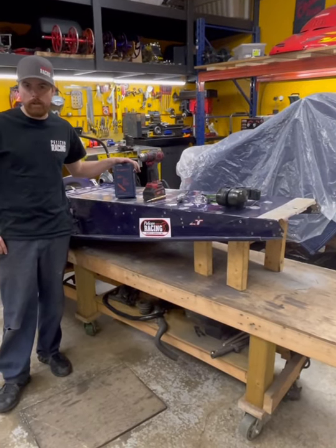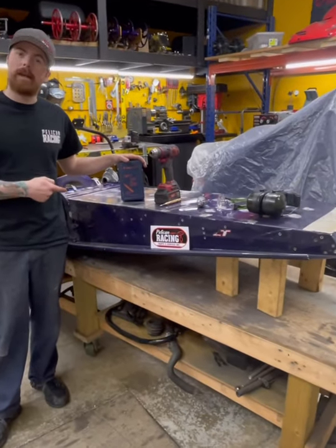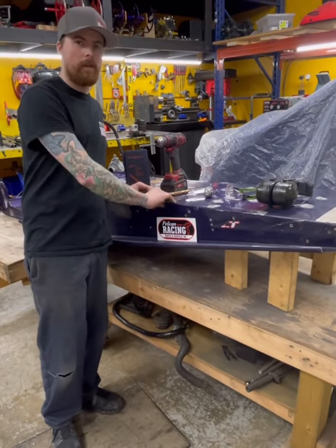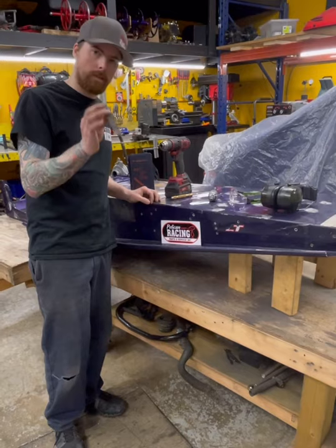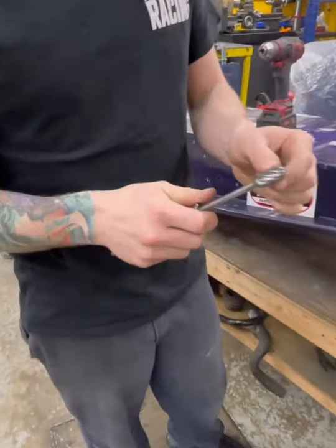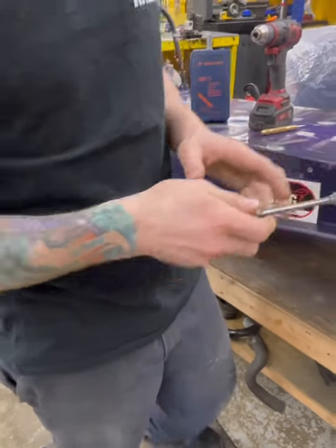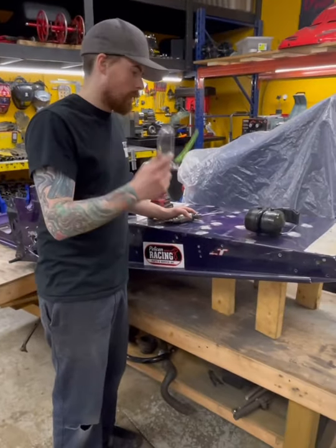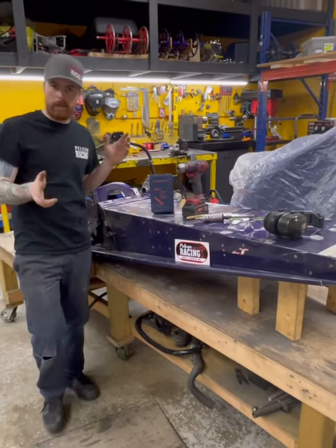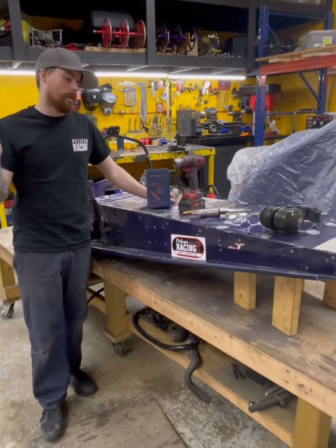Here's a quick rundown of some tools we're going to use. We're going to use a cordless drill with metric drill bits — metric, Canadian. We're going to use a center punch and a pipe to cut open the templates, just to cut around the holes nice and smooth. We're going to use an aluminum carbide burr bit — use a nice meaty one to take some material out. Take your time. Safety glasses, because no one likes aluminum in the eyes, and some hearing protection. That's pretty much all you need, along with some basic hand tools, sockets and wrenches for the mechanical side.